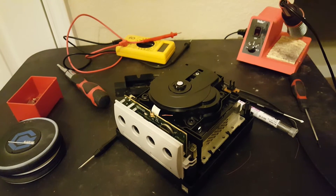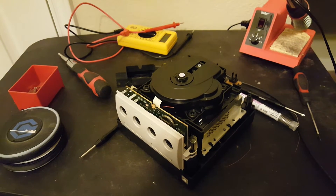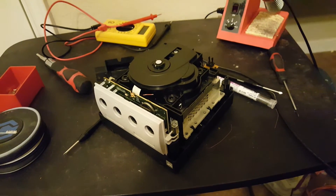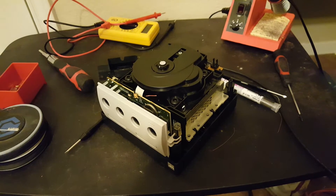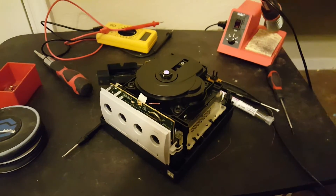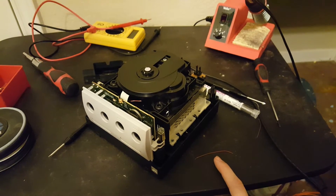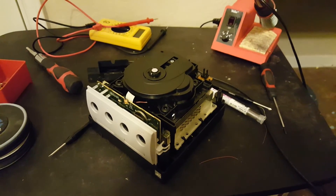Whatever you do, do not take your screwdriver and turn your potentiometer a quarter turn to the right like some YouTubers say. Do not do that. It will have awful effects on some GameCubes — really messing them up — and only okay results on others, since they're set at different levels from the factory. I had one where it was set to about 100 ohms — really low — and I didn't even have to turn it down at all to read games. This one is at 500 ohms, so a quarter turn might bring it to 400 or 350, which is fine. But on a different one, it could turn it down to zero, and your laser is not going to last very long at that strength.